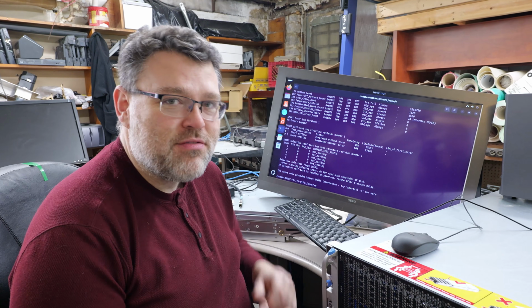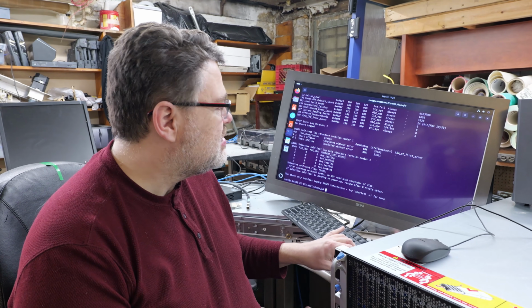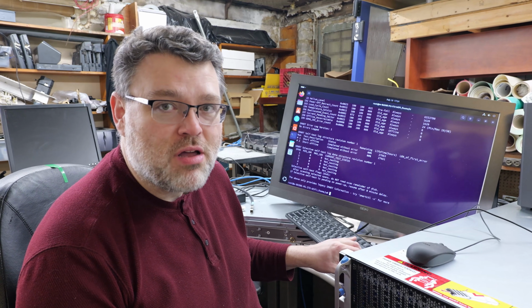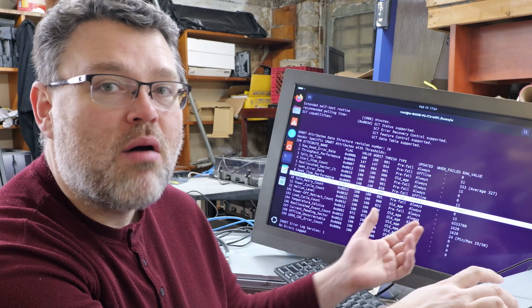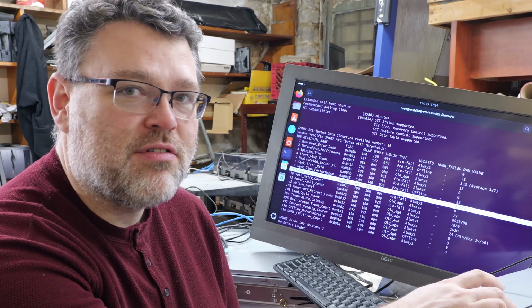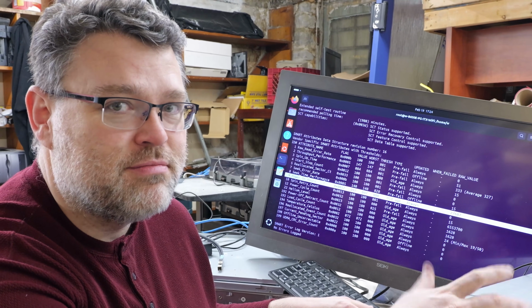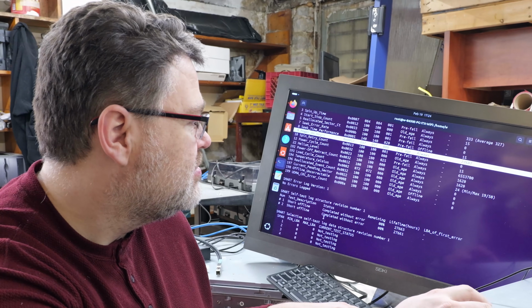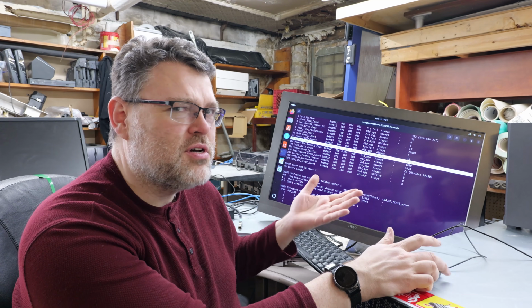So once you get your drive set up, you run tests. That's what you do, right? We got all kinds of tests. Even before we set up ZFS pools and everything else, you just run a lot of tests. Basic stuff. smartctl, smartmontools is useful for checking the drive. How many power on hours does it have? Power on hours, 27,687. Not a big deal for drives like this, 18 terabytes of storage. I mean, it's fine. You get a warranty from Server Part Deals. The helium level looks good.